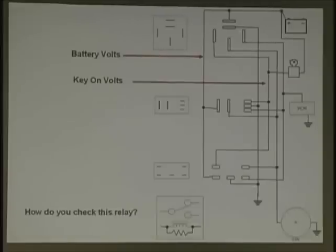And by the way, we realize that this is what part of the relay circuit? High amperage or low? The low amperage. Coil side, right? Okay, now your next question is control. What is going to control the relay?